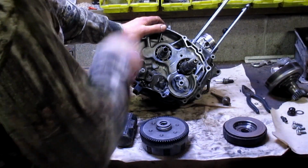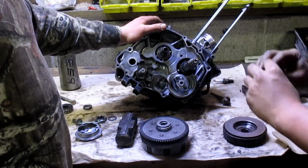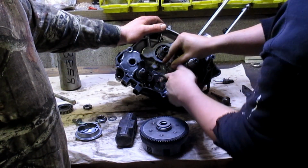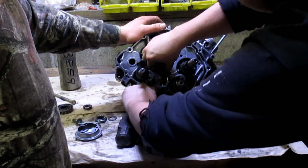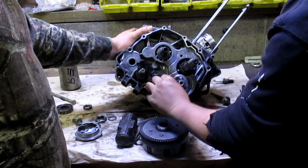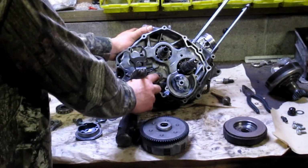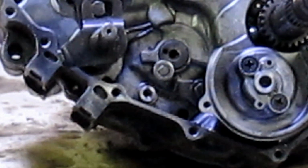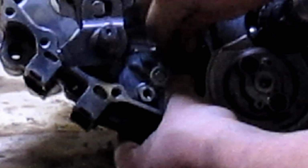Before you put your clutch and everything back in, you're going to want to put this star gear. There's just a little pin. It comes out, but it's not coming out now. Putting it back in. There's a little lever right here. Got a roller on it and it is spring loaded. Zoom in so you can see. There we go. Maybe what we'll do is use a flathead screwdriver and pry it out of the way, so we can slide that right in without breaking our fingertips off.